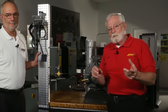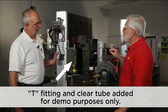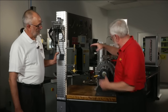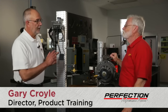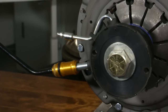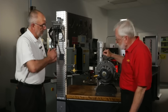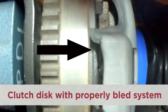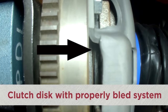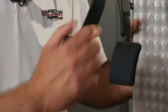We can't really see the air bubble in the line, so here's a display that will help us understand that. This is a basic Ford Ranger system: master cylinder, pedal assembly, line, slave cylinder, and a clutch. Right now we don't have the air bubble in the system, so when I push on the clutch pedal, the pressure plate is going to allow the disc to spin down freely — it shifts normally the way it should. Bring the pedal up and the clutch engages.